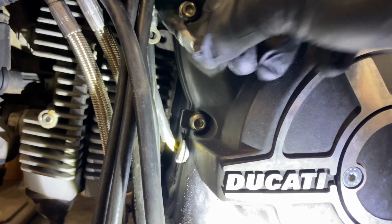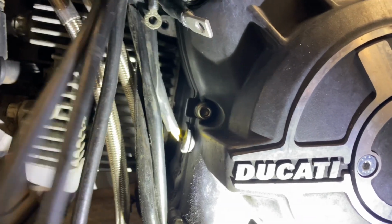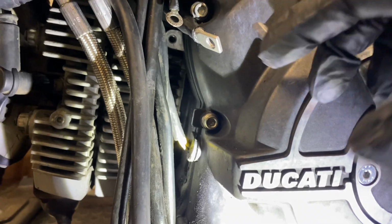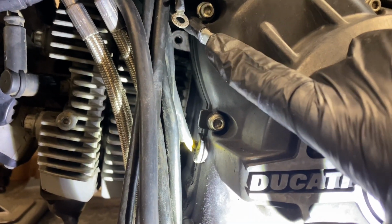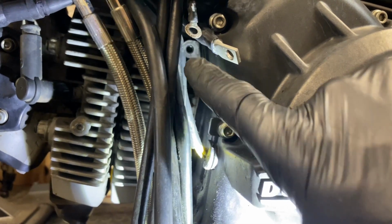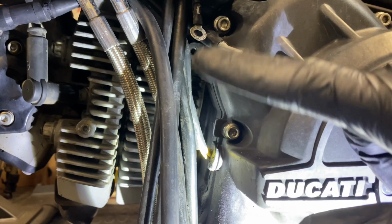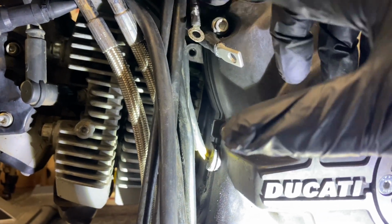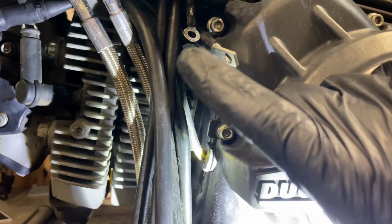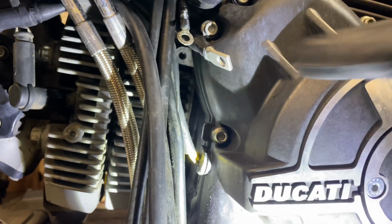And here's the new cable here, and piggybacked onto that is this other little hoop. I'm not sure where that's going, but that's irrelevant, so I'll replace that. So I will put the new cable flush against the plate. They say to use the sandpaper to clean the surface here, use the sterile wipes to clean it all up, use some of that special grease on there, and then bolt that in, which I'll do now, and then I'll show you that done.